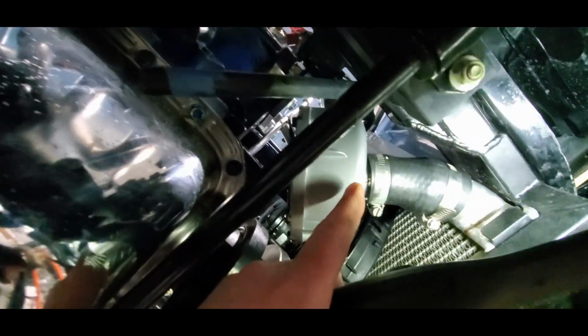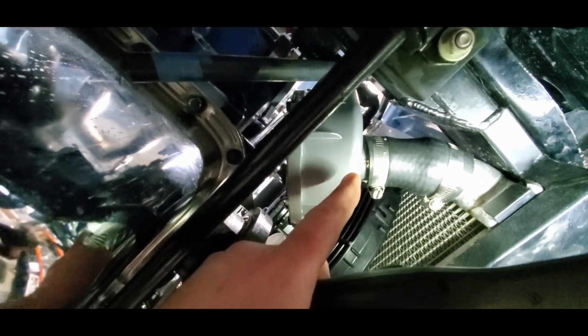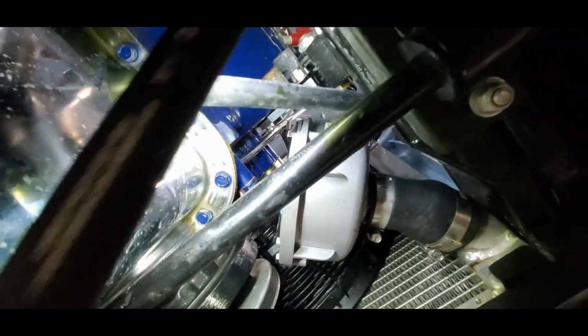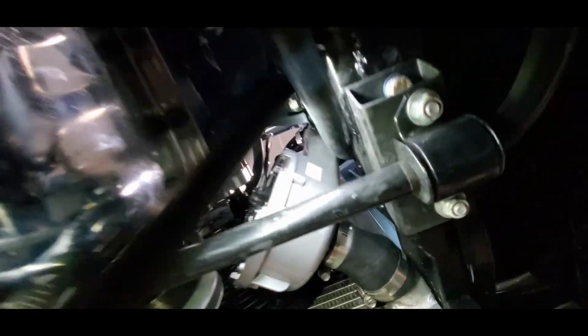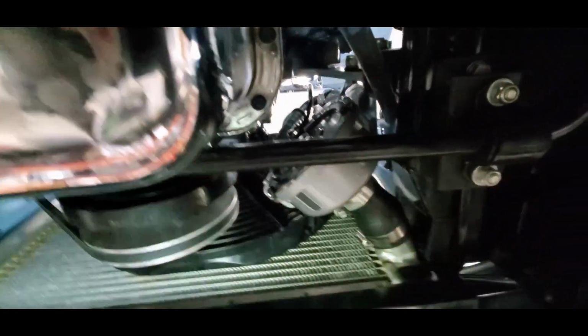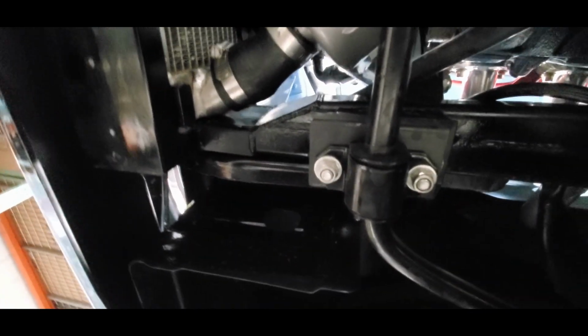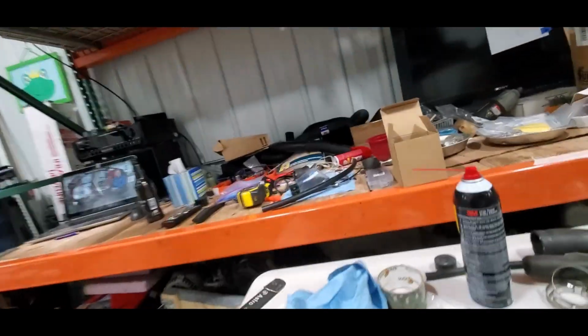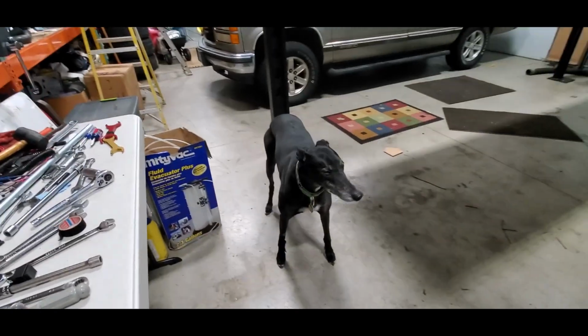One of the things I've got to face now is, and I just wiped it and I shouldn't have, there was a green drop right here. But look, follow that up. Ignore it on this hose. That doesn't matter. But you can see there's a trace along the pump up this side. So I'm about to drop the car and see if I can feel where that starts. It starts at one of those couplers. And we all know those are really fun to tighten.